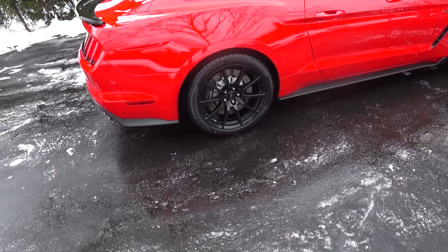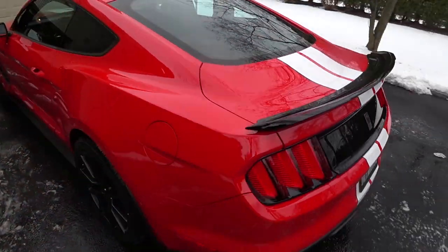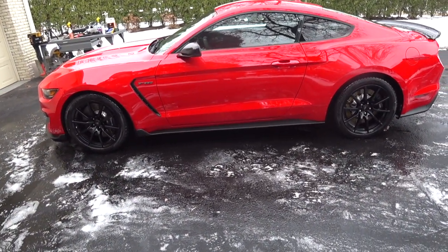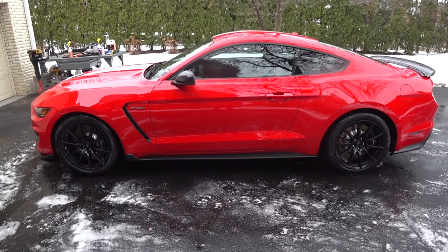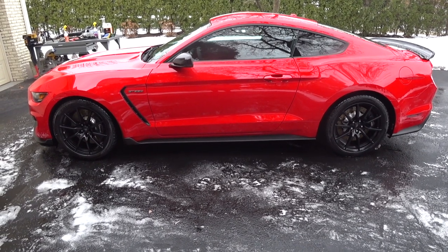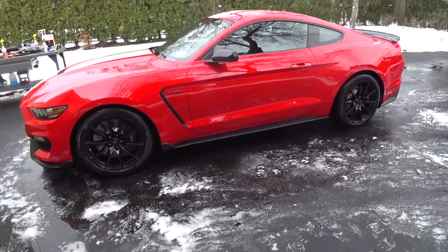Remember, 3 buckets, 1 3-gallon bucket for the wheels. I used the 2 industrial Rubbermaid buckets, and I showed you how I joined those together. Okay? Microfiber wash mop kit, you guys know all about that. Chemical Guys VO7 Honeydew Snow Foam, Sure Shot Sprayer, Solo Sprayer. Watch the beginning of the video, I'll tell you all about how I mix all those chemicals together. And Griot's PFM towels to do the wheels, the jams, to dry the car. Spray the VO7 on the towels, not on the car. And the VO7 prevents the soap and everything from freezing on the car.